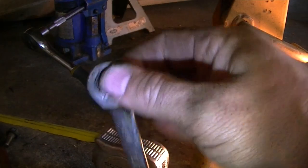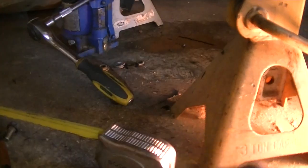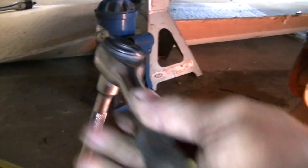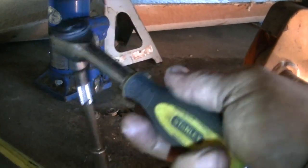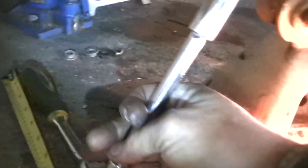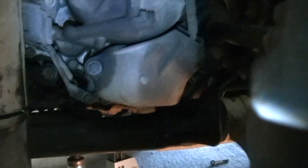To get in there you'll want one of these ratcheting-end wrenches — they're super handy underneath here. The only sizes I've needed are 10mm and 14mm; otherwise a regular ratchet and socket will do. This is a Stanley brand from Walmart, about $15. These are great because you can just twist it and it rotates, so if you don't have room for lateral motion you can still make progress. You can't put the same torque on it since it's only about eight and a half inches long, but it's a real bargain — I've used this thing countless times.